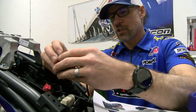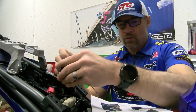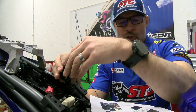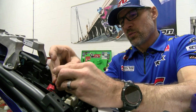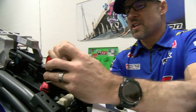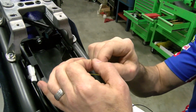That will be further secured, of course, once we put in the lock itself. Now position 22 is going to be the orange. Spread these apart a little bit so that you have good access. Orientation of the pin is going to be the same.